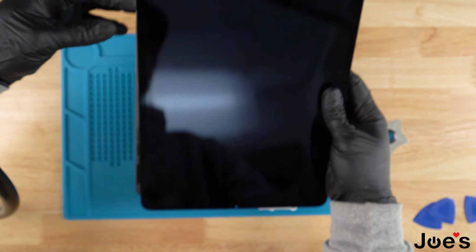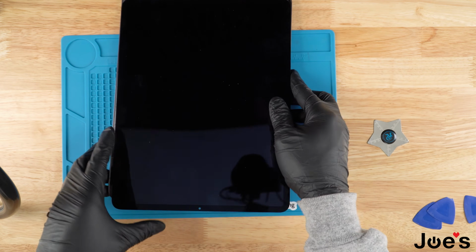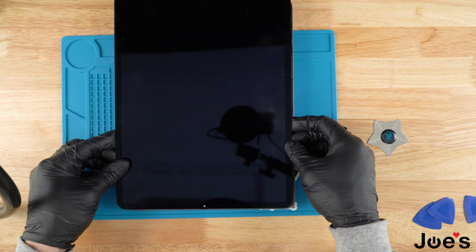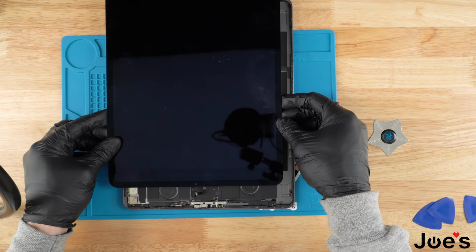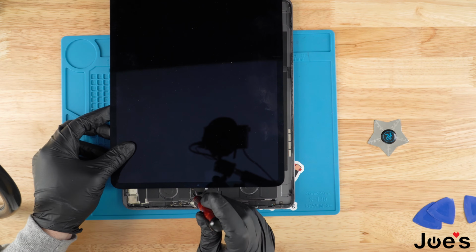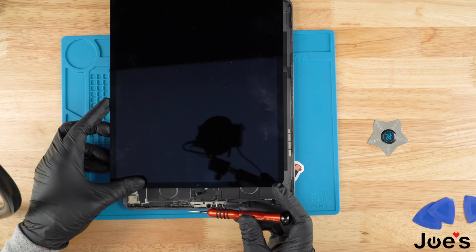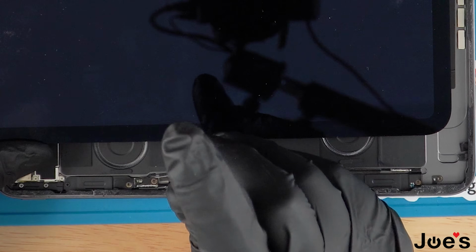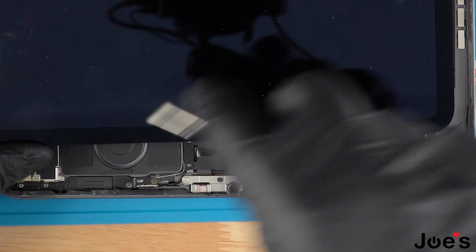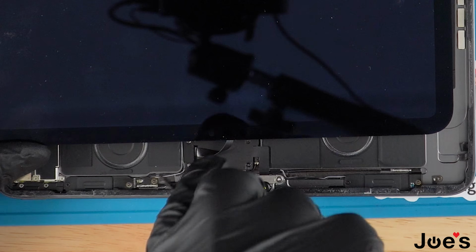Solid. Once we've done that, go ahead, flip the iPad upside down. When you remove the screen, you want to push this forward so that you can expose the Face ID ribbon. We're going to use a 2.0 Phillips plus screwdriver, which we do have on our website. The link will be down in the description. We're going to go ahead and remove these two screws.